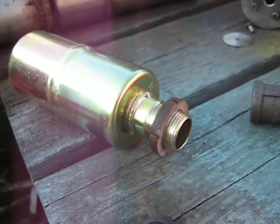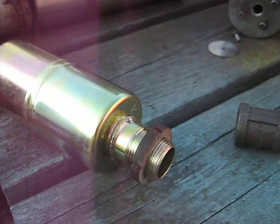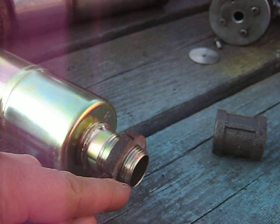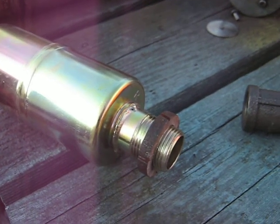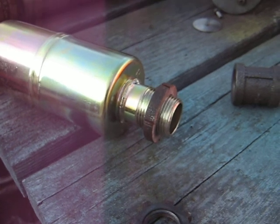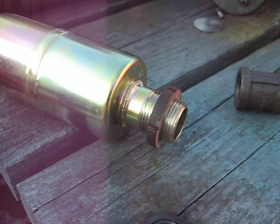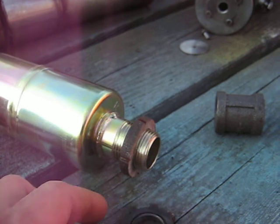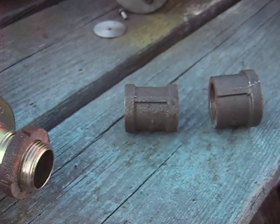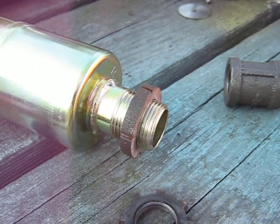I just thought it was an easy way to make it, because the one thing you don't want to do is screw the muffler in super tight, because the thread can come up close to the exhaust seat and it can still vibrate loose. That seems to be the best way to do it since the thread on this type of muffler doesn't have a shoulder like some of the short stubby ones do. Anyway, just wanted to show you my idea on how to use a pipe coupling to make two muffler nuts.